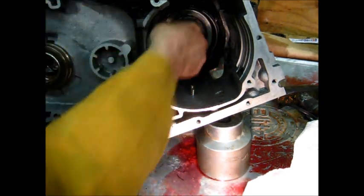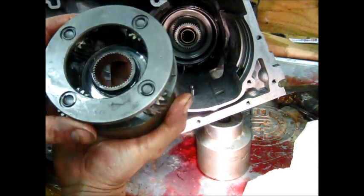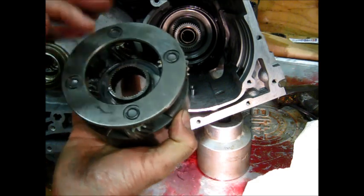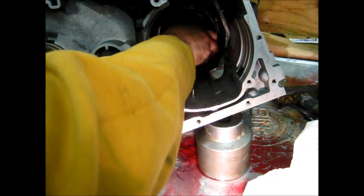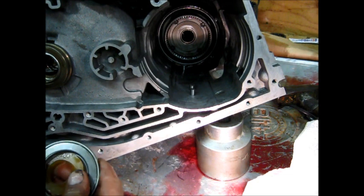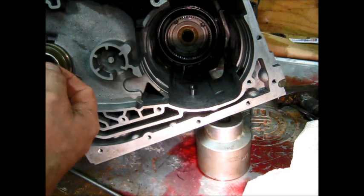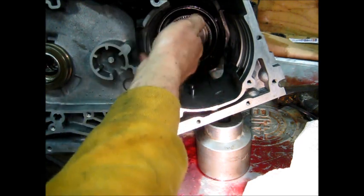Got a little oil on there. This one-two band had to be slid out around some other parts to do the in-frame job without taking the output shaft out, but now that I have the output shaft removed it should be easy — just slide it in place. It does have to be kind of flexed around a little bit, and there it goes — it's locked on the pins and on the servo. Next, a thrust bearing goes behind the drum — this is what that band is going to grip. It's actually a brake band — it stops the drum from rotating, and that works with the planetary gears to make first and second.